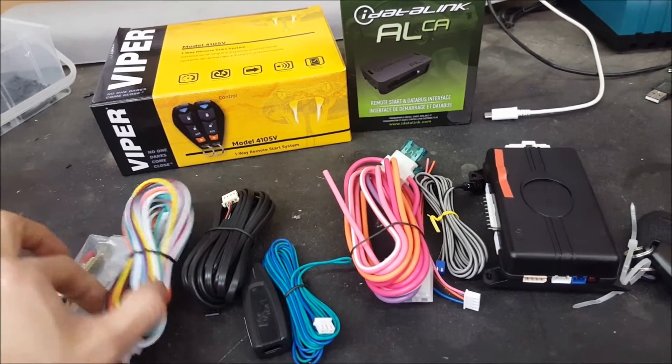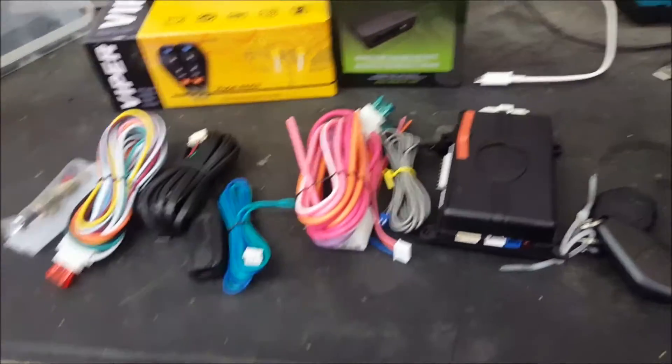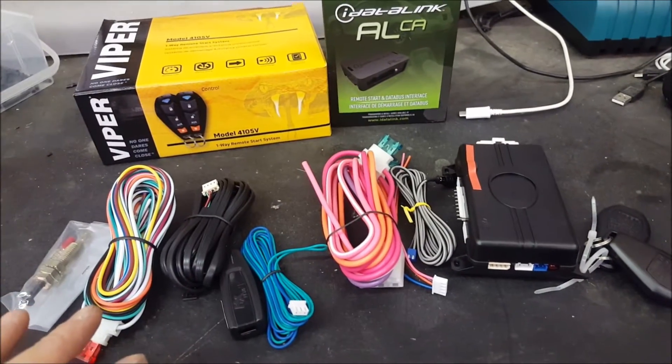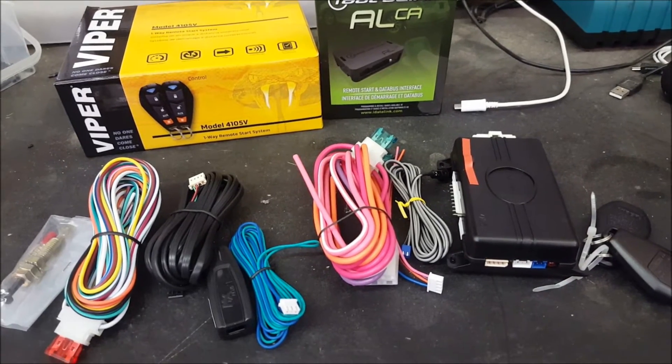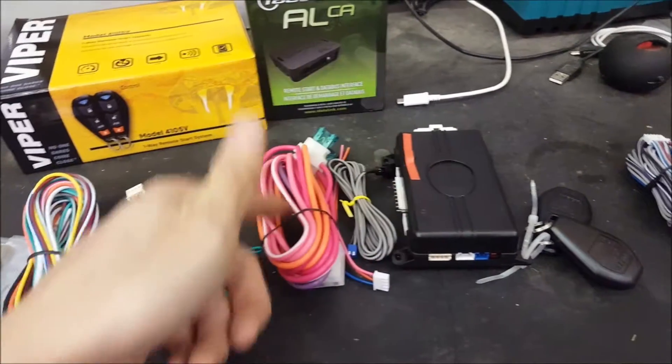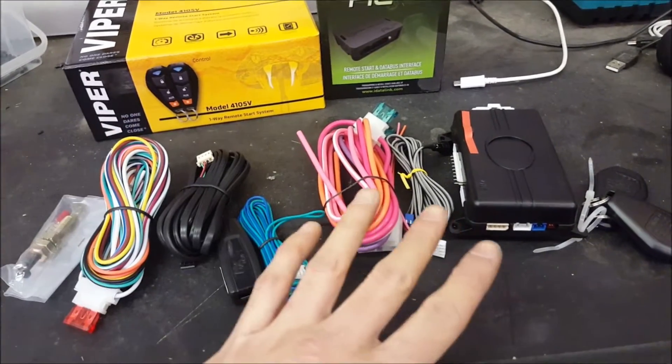Here's the keyless wiring and some other wires used for light flash, ground, and OEM alarm control. A lot of people think it's easy — just hook it up or plug it in. Well, yes and no. I plug these in here but I have to build the harnessing and then choose which wire, because this is a universal application.